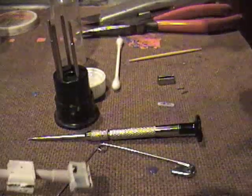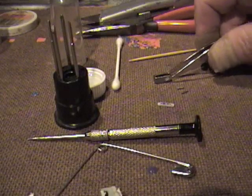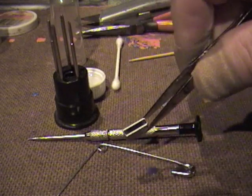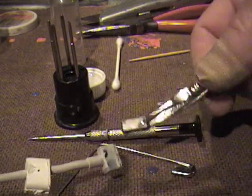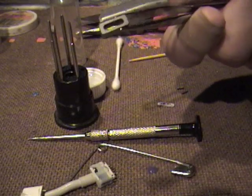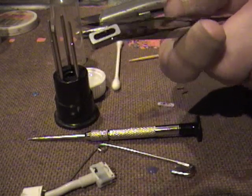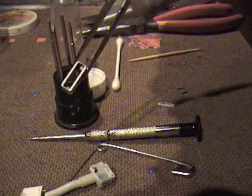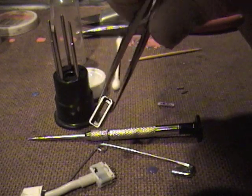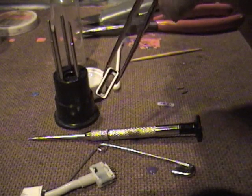I'm going to use silicone to put it back together — you could use epoxy or silicone. Then separate it by shoving a blade and just prying it up and pulling it back, so it fits on like that. Now we're going to get into the guts of the thing. This is the magnet, and that slides over the end here. Notice one end has a recess and the other end — the working end — has no recess. You can see that is the part that slides back onto the MagSafe socket.